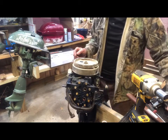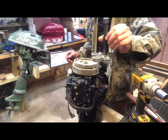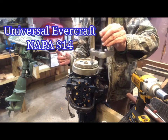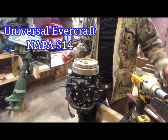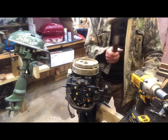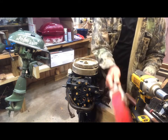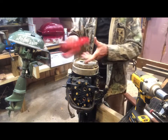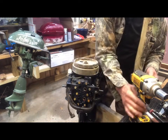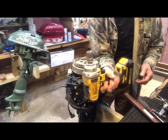What you're going to need is a flywheel puller — I've got the part number and where you can get it and how much it costs right here. A Phillips screwdriver, a ball-peen hammer. The hard way would be to use a strap to keep the flywheel from turning. The easy way is to get an impact drill and use that.